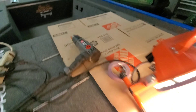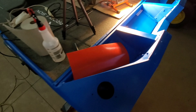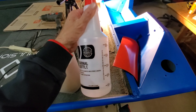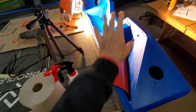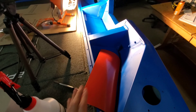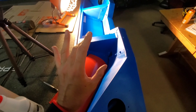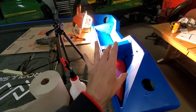Just in case, I broke out a heat gun and I'm going to lightly heat the tray before I install this. Another thing we've got to do is use the 50-50 mix of alcohol and water to clean it really good with paper towels. Then we're going to spray that solution on the surface to get it wet, peel the Gator Skins, and lay it down over the wet surface — that's going to activate it and help it bind.